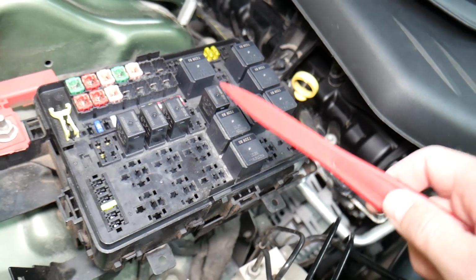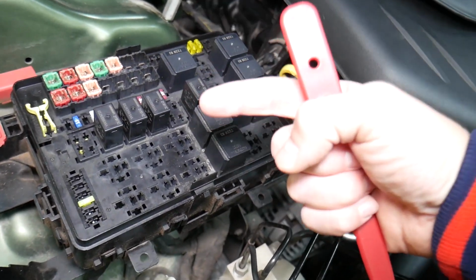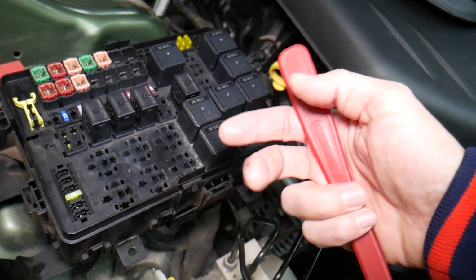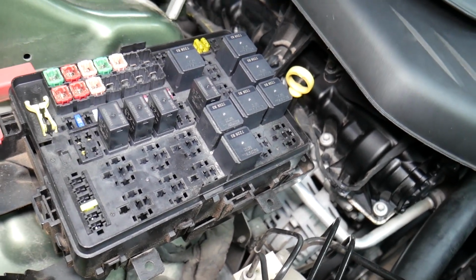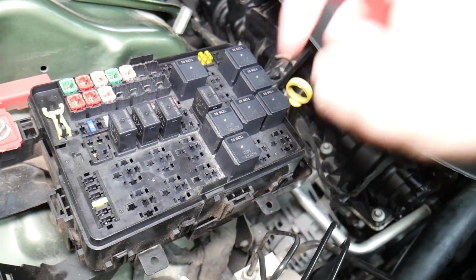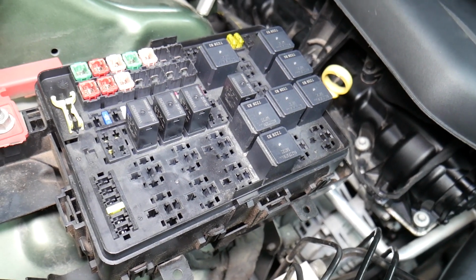But when disconnecting the car battery, guys, a common mistake people make, it's important to know which battery terminal you reconnect first. If you do it the wrong way, you can burn electronics modules. How do we know about that? We burned the traction control module on a BMW before that cost us $2,000, guys. So we'll put a link in the description of the video below on which battery terminal to disconnect first. Check it out for your convenience.